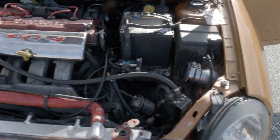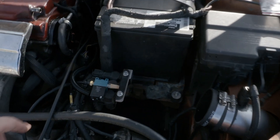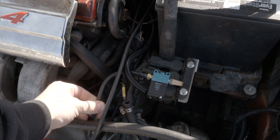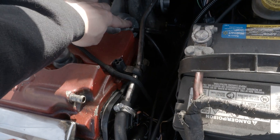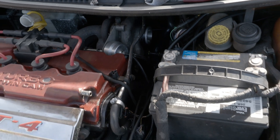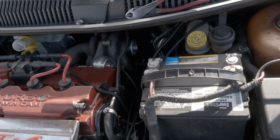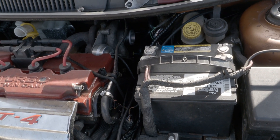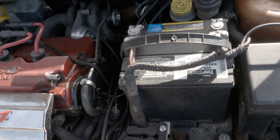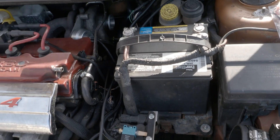Update time — we're currently cleaning rims, but we got our solenoid installed and all the boost lines ran. One line goes to the wastegate and the other is from the charge side of the turbo. What the solenoid does is it prevents the wastegate from seeing boost so it doesn't open. When the boost controller hits whatever PSI you set it at, it opens the solenoid and allows boost to go into the wastegate to bleed it off.